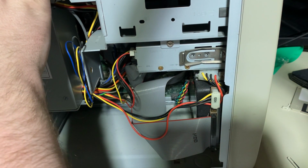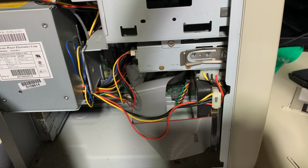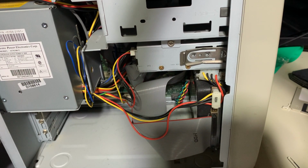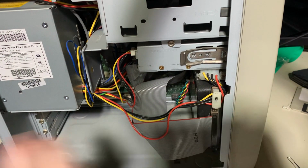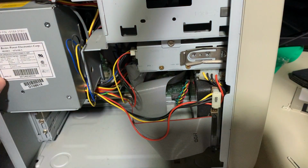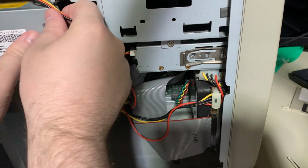I like to get this power supply moved out of the way before I really delve into any real troubleshooting. Even if I don't see any bad caps, unless I find an obvious culprit, I may just take it upon myself to try and recap this board in the hopes of restoring it, because I don't know if this is at the beginning of capacitor plague or right before it, but either way, capacitors go out even if they're not in any particularly plagued form.